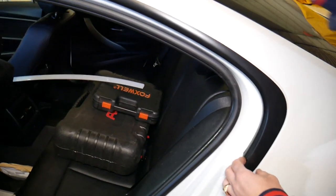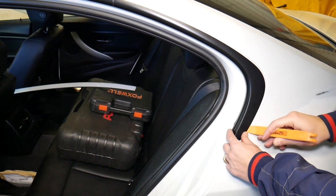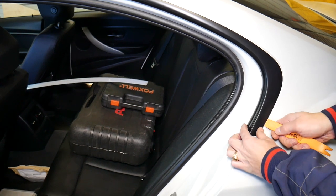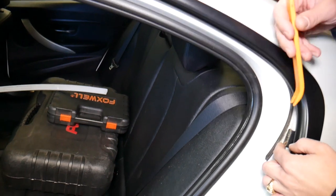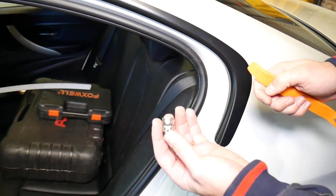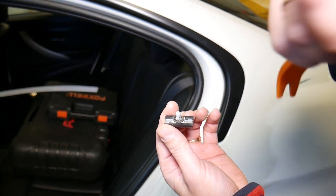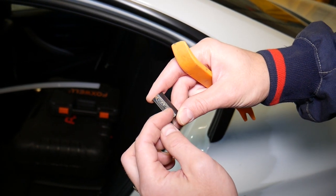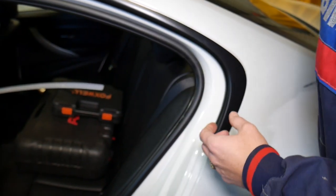Right here you have one clip — this is the hardest one to do. Ours broke. You go in with a plastic panel tool and you need to push that way. When you push that way, the clip is right here — let me get it out. That's what it looks like. This clip is supposed to be glued to the rail, but in our case it came loose, so we have to re-glue it. We're going to use epoxy to re-glue it and install it later.